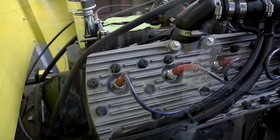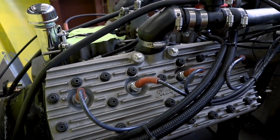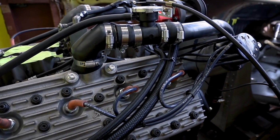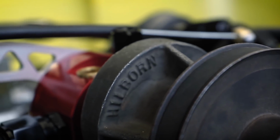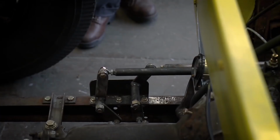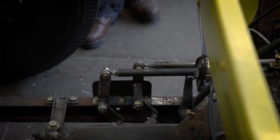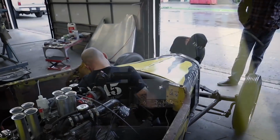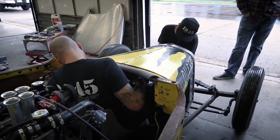Where'd you put that leak down check? It's a 59A. It's a 286-inch flathead motor that Al from Go Devil Garage built. It's got Hilborn fuel injection. The transmission's a 47 side shift trans. The rear is a 47 rear. Other than that, that's kind of it. The rest of it's just linkages and brackets and bell cranks to make it work.